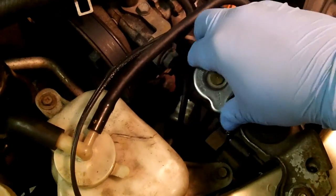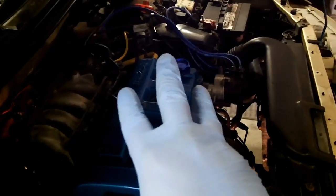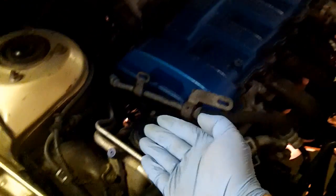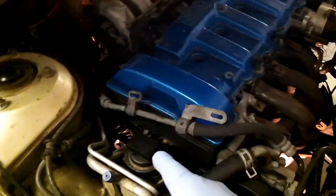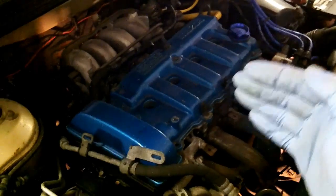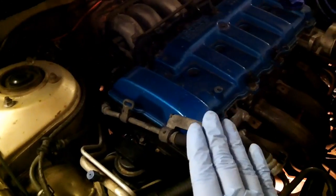And next, I went ahead and cleaned off the top of my radiator cap. We're just going to reinstall that. Okay, and that should do the job nicely. And all three of those transmission mounts should be good enough to hold up the entire transmission and the engine. So you can relieve just the one motor mount, take that out, support a block of wood underneath, you'll be just fine. And I know that's the main load bearing mount because during my transmission swap, I had all three transmission mounts off. The rear, the passenger, and the front. All three of the mounts completely off, as well as the transmission was off. Only the engine I was supporting 100%, which I should not have been, by that mount.